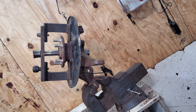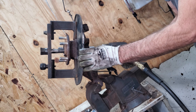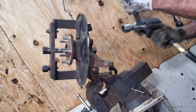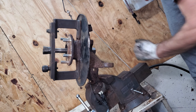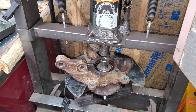If the wheel bearing treats you that bad, I guess you've got to use a hub tamer on it, or just give up and take the knuckle to a mechanic shop and say 'get this thing off for me.' I'm going to bend the backing plate a little bit, but it's just a backing plate - I'll be able to work with it. There's no way it's moving. I'm going to have to put this whole unit in the press.